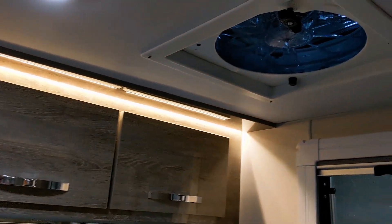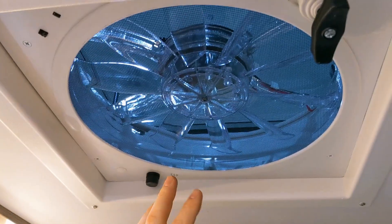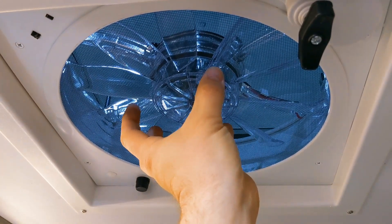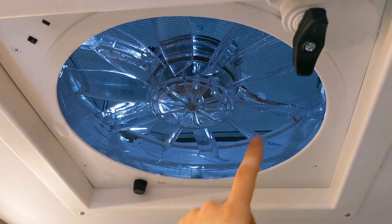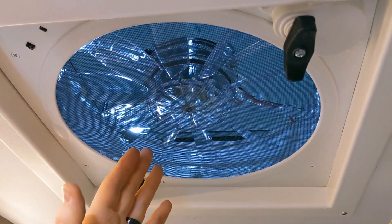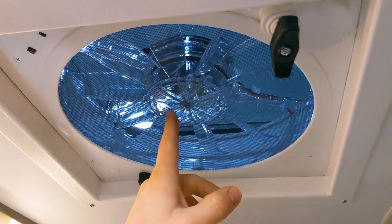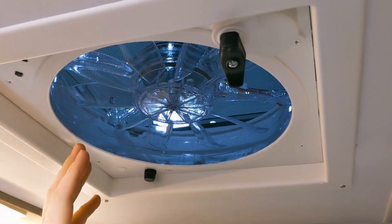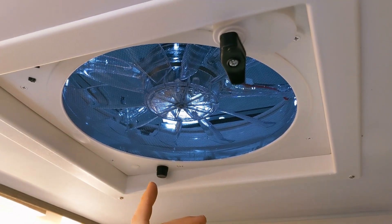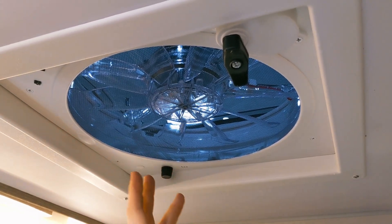If you look in here and get close to the fan, you can see it's four to six times bigger — it literally fills the entire opening where that other tiny fan was. It has more blades and they're thicker. These last longer too; those other blades get sun on them and fall apart real quick. I've had ones over ten years old still not falling apart in older RVs that have these, which is really awesome for durability. It also has its own little fuse in here, and this one is automatic so you don't even have to touch it manually like the others.